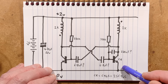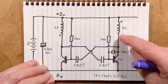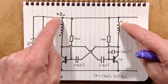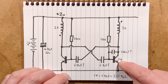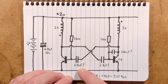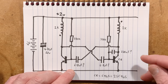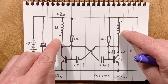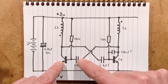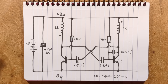This is where it gets difficult to describe because it's continually changing, but suffice to say: when this transistor starts turning on it induces current flow in this coil — because this end is pulling negative, the dot end is positive — and it echoes in the other coil, coupling via this capacitor to turn that transistor on fully until it reaches saturation. I measured the capacitors in circuit as 7 microfarads, closest is 6.8 microfarads, and roughly 220 nanofarads for the other. Once the field starts collapsing, it does the opposite — drives the other transistor — and so it just basically starts toggling backwards and forwards at high speed.